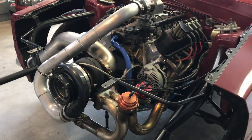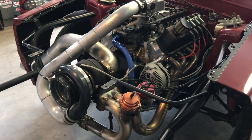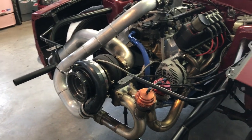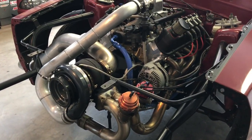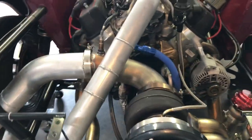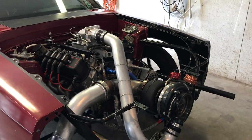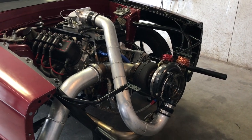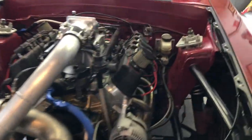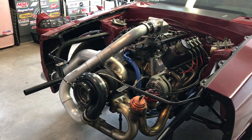Anyway, stay tuned if you want to see this thing run. I'm going to have to do a little street tuning because of the methanol — it all runs and everything, but in boost we're going to have to take some fuel out because methanol in itself is a fuel, so it's like adding an injector to the system. It turned out real good, I'm real happy with it. I still need to get a blow-off valve welded in — I have one ordered, that'll take no time. Other than that she's ready to rock and roll! Thanks for watching guys, subscribe, and I'll see you in the next one.